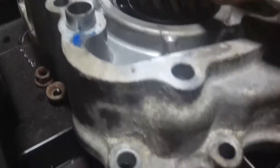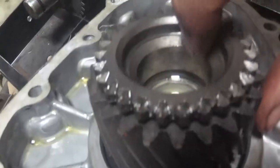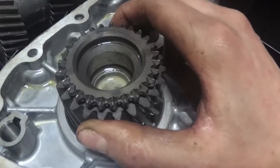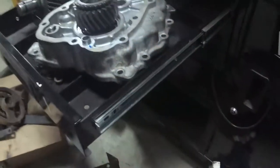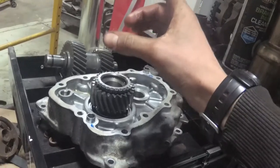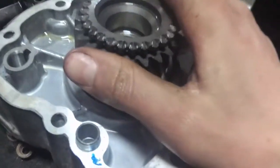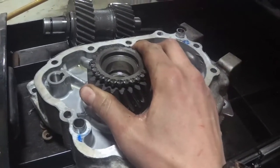Hopefully that works. There's a hole drilled all the way through on the inside, kind of in that groove, and that shaft will probably make it so we can stick a pin in there too, to hopefully make it a little stronger. Just welding around here is not going to be that strong, but I don't know what else we can do because we're trying to be cheap and not have to spend any money. I was originally going to make more of a housing — kind of like a tail housing on a two-wheel drive transmission with another bearing in it for the shaft — but I'm not going to bother. This is a big old bearing, and there's a bearing in the back of the transmission. I don't think we're going to be putting too much force on there.